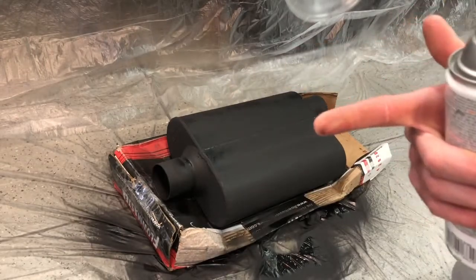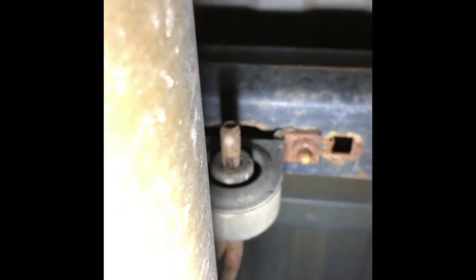Now we're going to get right into the install. First thing is to take off the old muffler - I'm very surprised it's actually going to be very easy. As you can see underneath there, on these new F-150s they just have two bolts right there that hold the support beam onto the muffler. In the back there's only one bolt holding the support beam on. All the bolts holding the muffler are 10 millimeter, so that'll save you a few trips back and forth.